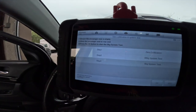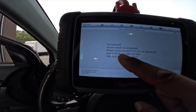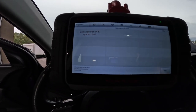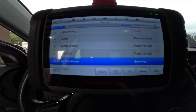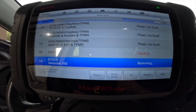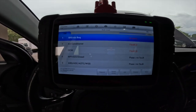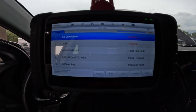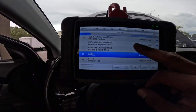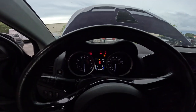There's nothing on it — test pass, all procedures completed. Please erase stored DTCs set during the test in OCM and SRS airbag. The SRS fault is on — what we don't want is the OCM fault. OCM should be clear. We have three faults and we're gonna see if it resets. I'll click erase — it erased! Look at that, no codes.